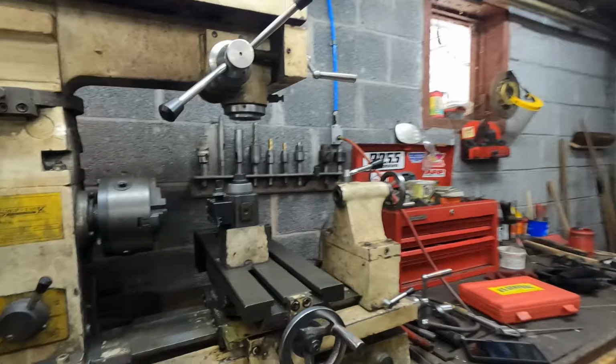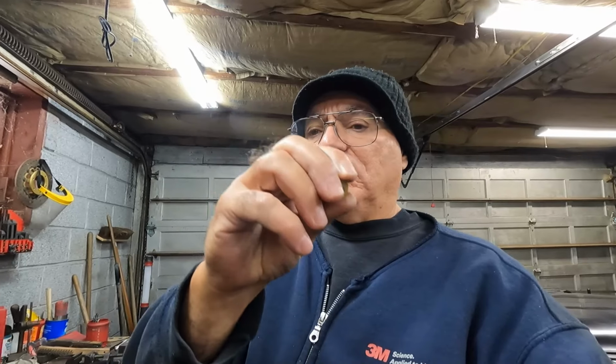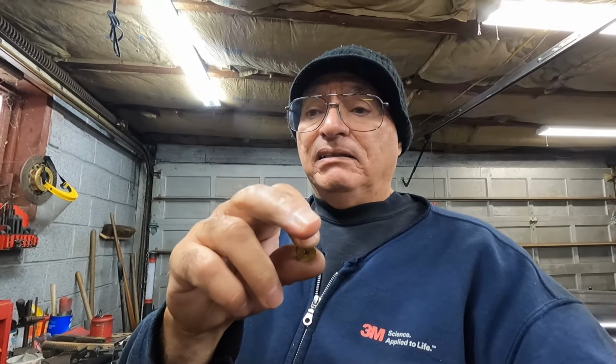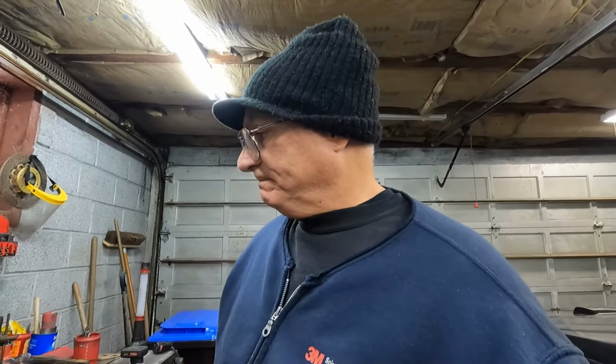And you don't need a lathe or a milling machine or anything. Just get a little plug of material. Could be plastic. It could be steel, aluminum, anything that's not going to break apart and get sucked down that hose into your crankcase. And if that happens, that could be bad. So just keep that in mind. And what you need is to drill a little hole in it. You can use a drill, a little Dremel tool, whatever. You can experiment. It's good to stick the vacuum gauge on there and experiment a little bit. See what kind of vacuum, dial in your vacuum perfectly. That definitely doesn't hurt.